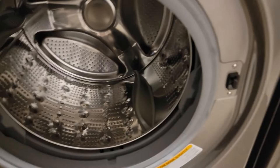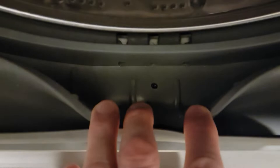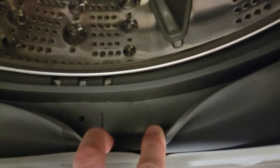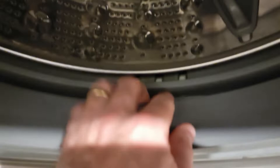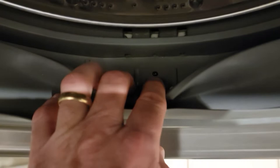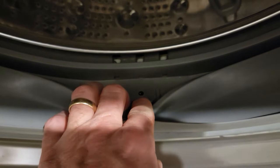My wife goes through the process of cleaning it out as recommended, but even after we clean it out we still smell this smell. We've decided that drain hole right there is the issue — there was standing water in here. After washing loads, standing water remains. We tried putting a machine screw down this hole and when we pulled it back up it was just dirty and mucky, and the water still will not drain.